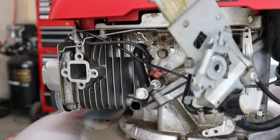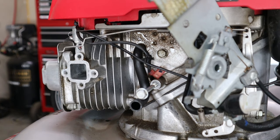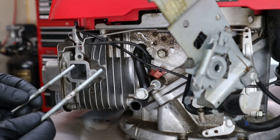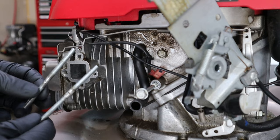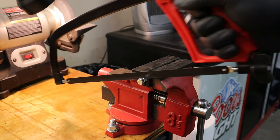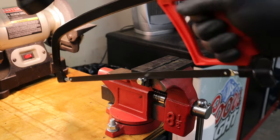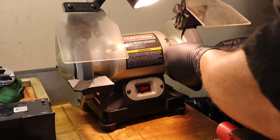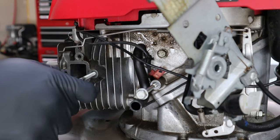It's time to reinstall, and this is where it gets fun. I mentioned earlier how I said this isn't the best design, and here's why. If you take anything away from this video, please take my advice on this: install these studs — they're going to help you reassemble the carburetor the easy way. You can buy these on Amazon for about $12, or get some cheap Harbor Freight bolts from a variety pack — the size is M6 by one. Go ahead and cut the head off, line her up and stick them together, grind her down a bit so she's smooth, and you're welcome.